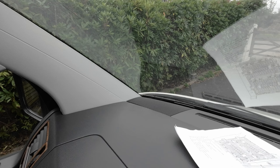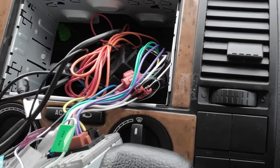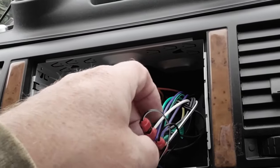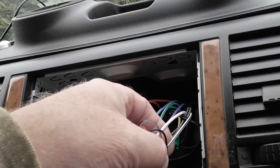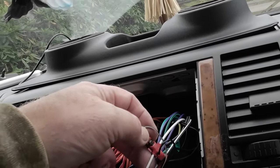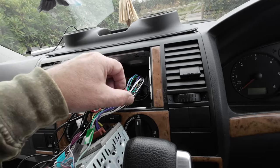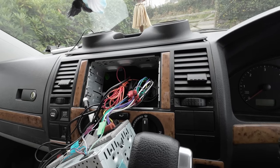All we need to do now is wire them back into the head unit. We've wired the tweeters in, and you've got to be very careful with polarity. The white and grey are left and right — solid white and solid grey are positive, grey-and-black and white-and-black are the negatives. They supply two T-connectors but I needed four, so I've had to use scotch locks on the other two. The T-connectors are really nice — if anybody knows what they're called please tell me below. So much nicer than scotch locks.